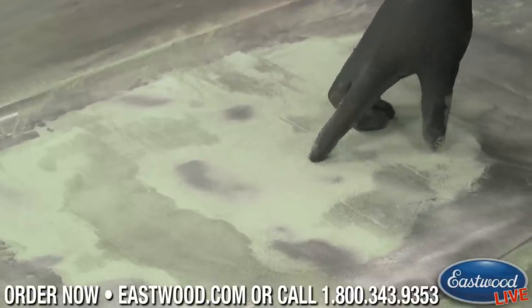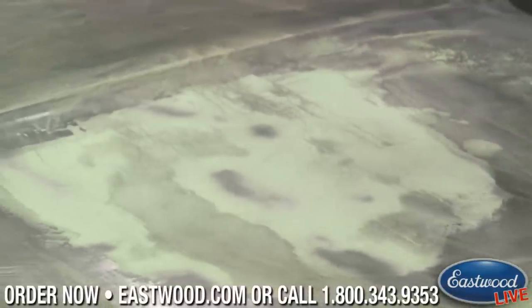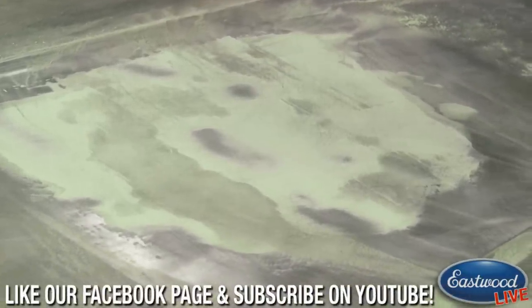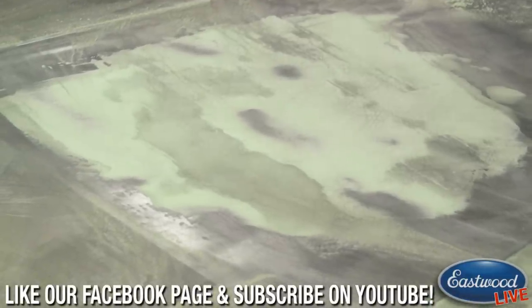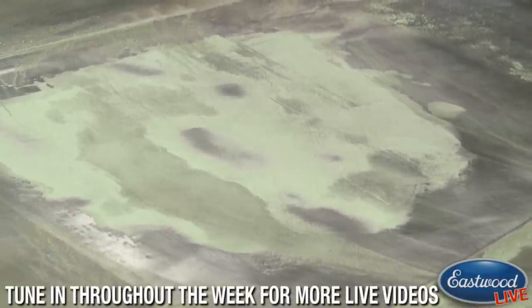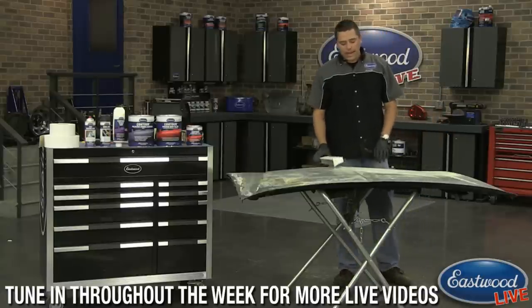And the reason being is, if you put any kind of glazing putty or any kind of primer over that, it's such a deep scratch that it's going to wind up potentially shrinking back on you, or it's not designed to hold in such a large scratch. So you'd wind up having it come back out again.